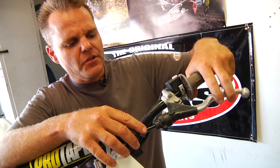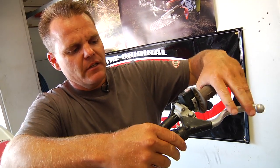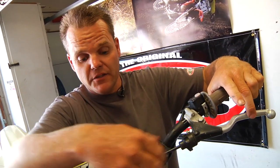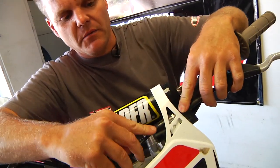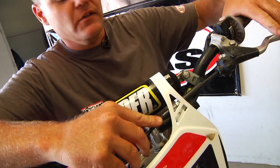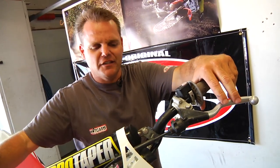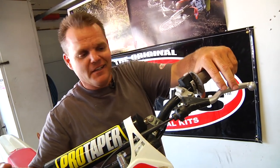Now we just want to make sure you have proper play. Dial in to where you have a little bit of play. If you don't have enough with the main adjuster, your adjuster is right here in the cable — you can get a little more adjustment from your old clutch cable. Make sure we've got a hair bit of play and we're good to go. New clutch — you'll be able to pull out of the turns way faster and have a little more fun.